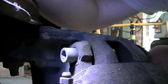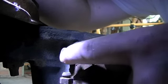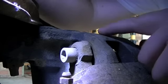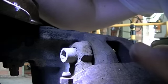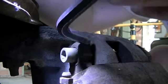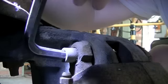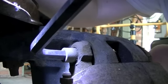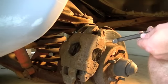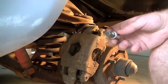Here you're looking at the backside of the caliper. The first order of business is to remove these bolts — they slide through the spindle. This is a floating caliper so it can move back and forth. What you do is come in here with a 3/8 inch Allen wrench, stick it in there, and it's the same old lefty-loosey righty-tighty. You can also use one of those socket tools with the Allen head on it.